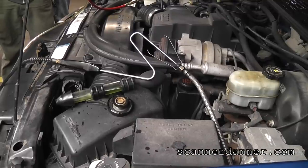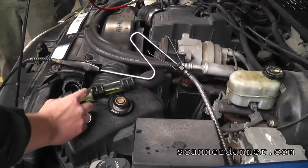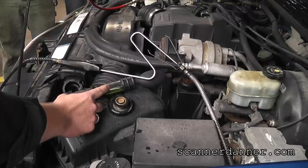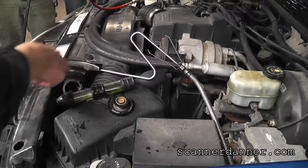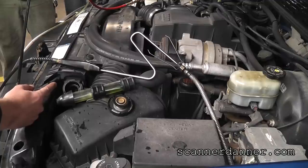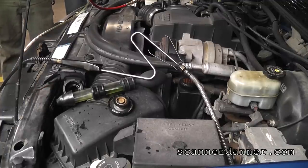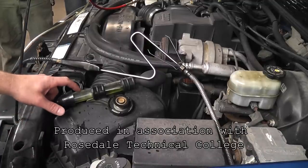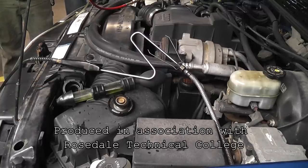Final thought with this - if this is all you have, we pulled exhaust gases in and it did change color, but it looks like it has to be a really high concentration for any kind of change. There was 200 to 500 parts per million hydrocarbons confirmed with the gas analyzer - there shouldn't be any, and over 100 is confirmed head gasket failure. You'd have a hard time calling a head gasket with this chemical kit. I am not a fan. You guys without a $5,000 gas analyzer, sorry to tell you, you're going to miss some of these. I'm sticking with my gas analyzer. Take care.